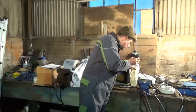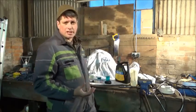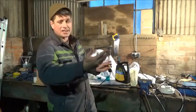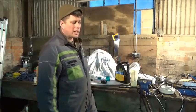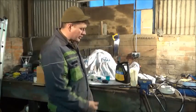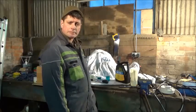Let's just have a quick look at pure water - all six discs have sunk, so obviously it's got no protection against freezing. It is important though - it's not just a case of 'something there will do.' This tester costs about 10 pounds in the UK, about 10 bucks in the States, so it's worth having one in your toolkit and just going around your vehicles checking you're covered. Because for the sake of a tenner and maybe 20 or 30 pounds of coolant additive to top up, you might save several thousand pounds worth of repairs if you've got a cracked head or block in cold weather.